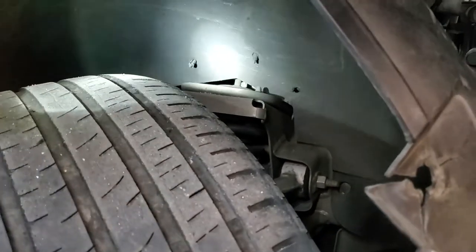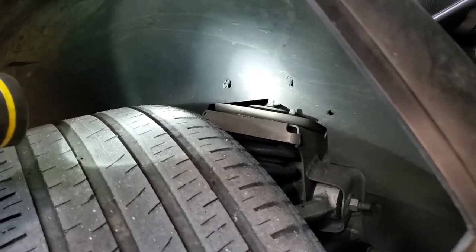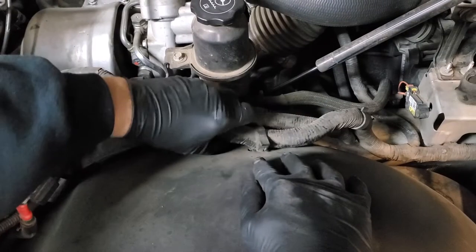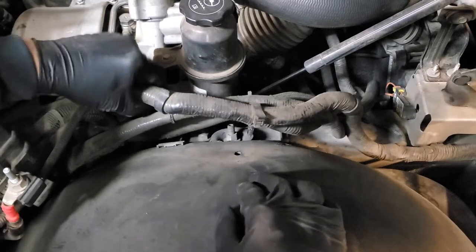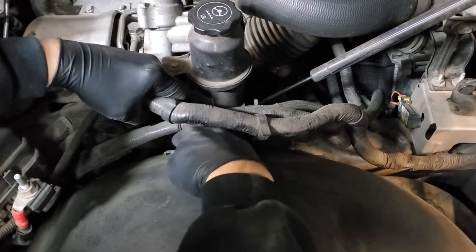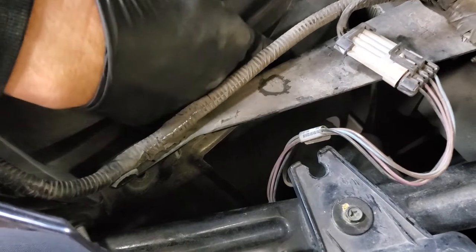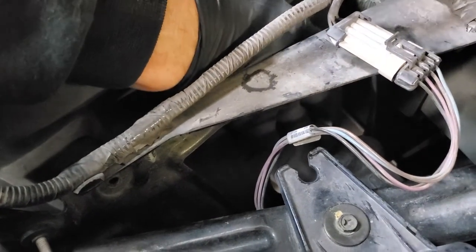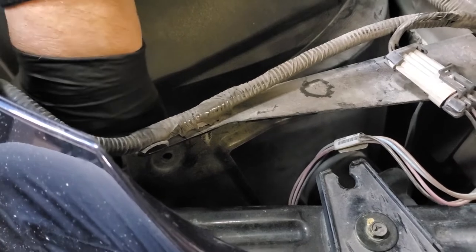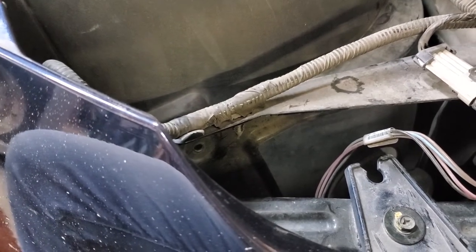Our inner fender liner is still connected by two Christmas tree fasteners which are holding the wiring harnesses. That's the only two things left that are actually physically holding it on, so we've got to get those out. Grab onto your wiring harness, push hard, and pull at the same time. Got one out. The other one still has a wire tie attaching it, so we'll pop that when we take this out of the car. Down below there's a brake cooling duct that's holding this in a little bit, so I've got to push it off the duct — that takes a little effort.